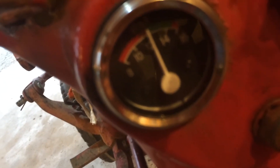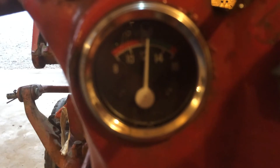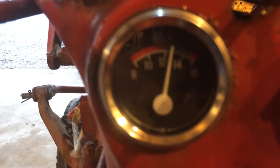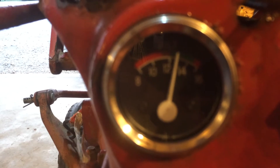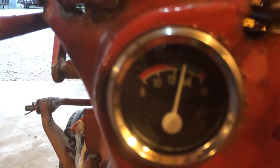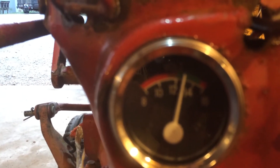I was playing with the lights a little bit — see the voltmeter come up. Now I'm going to pull the starter rod and we'll start it back up so you can see what the voltmeter does. You can tell the voltage has actually gone up just a bit. Our alternator is charging even at low RPMs, which is a good thing.